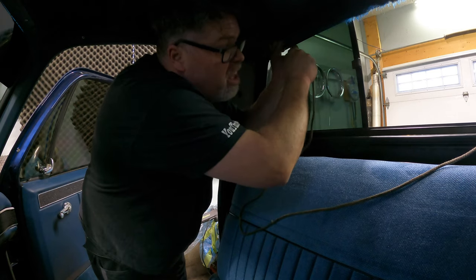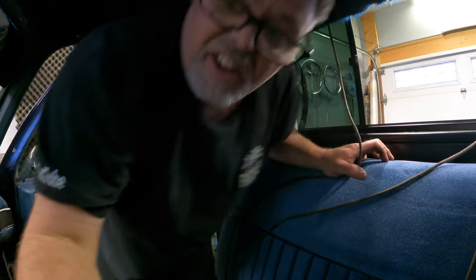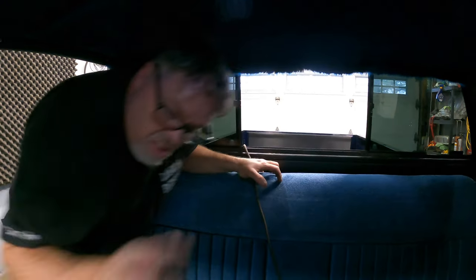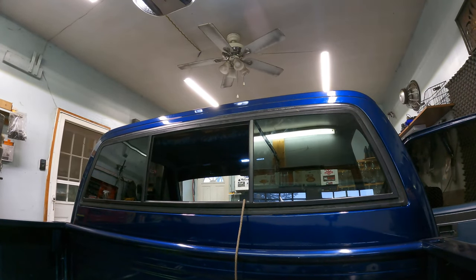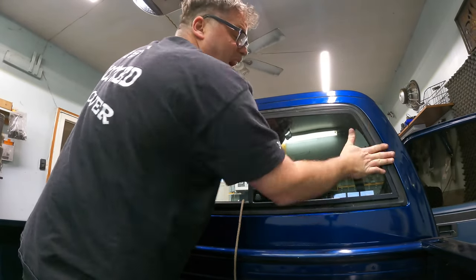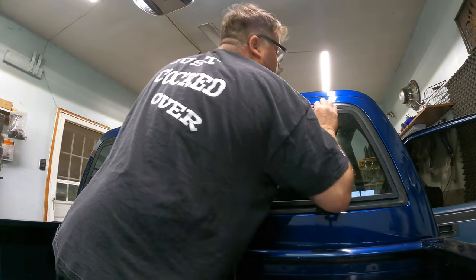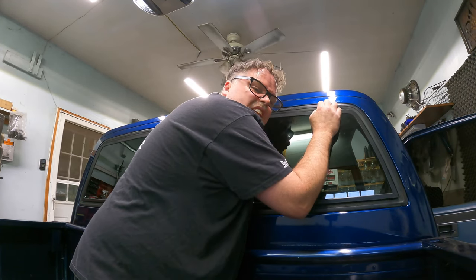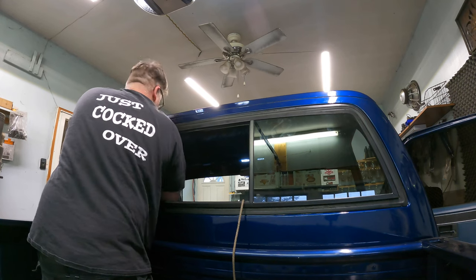She's going! We're winning this ball game. How are we feeling up there? Not bad. I gotta give it a tap or a pull — let me get in here with you guys. Give it a little pull. Perfect, boom! So once you get it in, you want to go out here and eyeball that thing. Not bad — might need a little tap here, a little tap there. That slider looks so much better. Tap, tap. Feels good. Bring your fingers along the rubber, feel it, pull it down if you have to. Give it a little tweak right here. If you have a little bit sticking out like that, it normally means the rubber's not quite in. Feel along here — yeah, good.